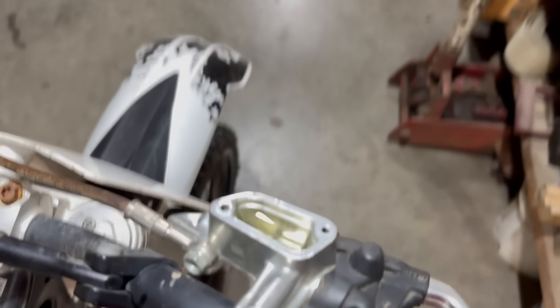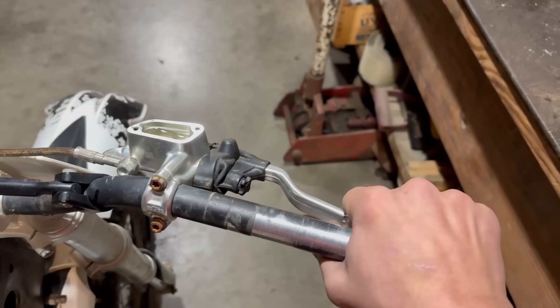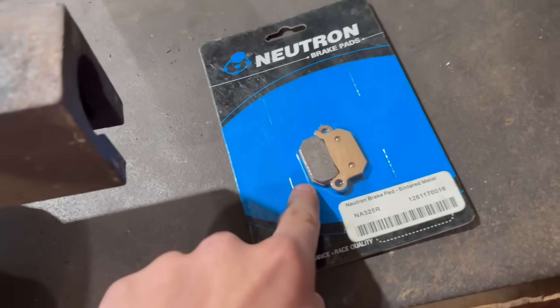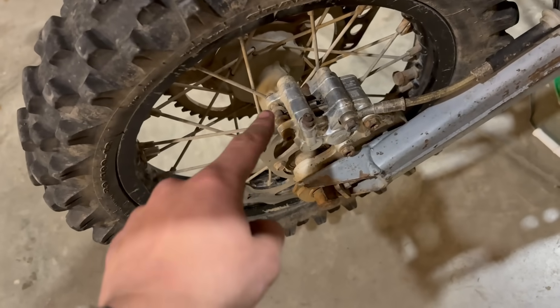I decided to open up the front brakes and there was like no fluid. So I added some DOT 3 brake fluid and I've been pumping them and letting it bleed — it's kind of gaining pressure. I also need brake pads. Rear brakes are good, just need brake pads — there's nothing left. I'm going to buy brake pads, but these are meant for the two-piston rear caliper. This is a newer KTM with a four-piston, so those pads don't fit.